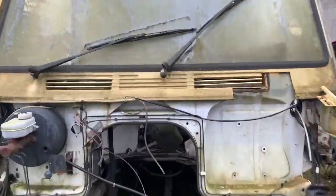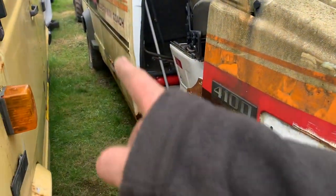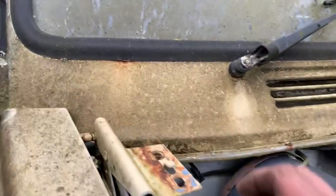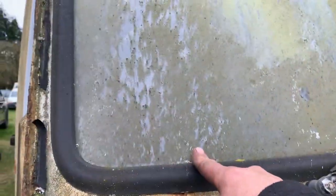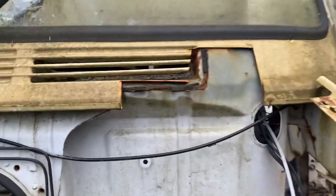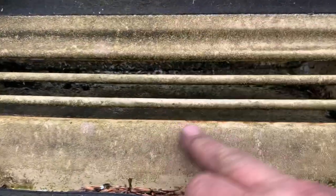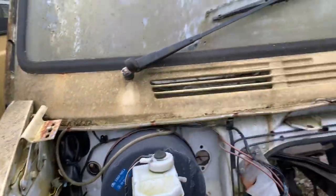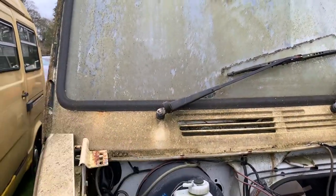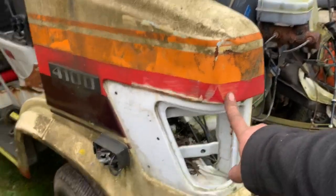I have this — it's a 410D. It's fairly rusty; down the sides is knackered, as you can see. That's why we took it apart. But the screen panel's good. I'm going to have to take the windscreen out. I forgot to add the windscreen removing video to the first link — I'll shove it in this one so that you know how to take a windscreen out. But as you can see, the bulkhead on this one is absolutely cracking — there's no rotten vent panels. These are only glued, literally sticky tape, to the outside here. So I will pull the wipers and pull the windscreen. Save the seal because I don't think you can get them.